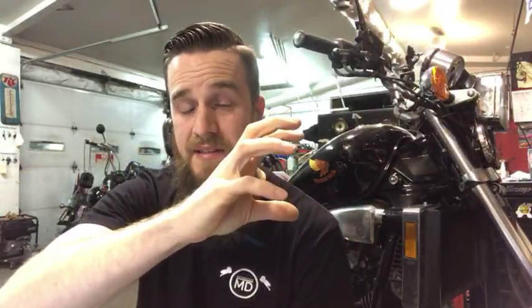Maybe what's happening is you're revving the bike and all of a sudden it jumps up and just stays up there, even with the throttle depressed. I would double check to make sure that your butterfly is returning back to normal, that you have proper throttle cable free play. Because if you rev it up and that throttle is just being stuck there, then that's your problem. I don't know how the Suzuki 250 operates as far as carburetors go, but visually inspect the throttle on that, man. Just make sure that it is returning back, your idle's not set too high, and if it has twin carbs, that they're synced right, because if you have a throttle plate that's like this, it's going to idle high all day long.